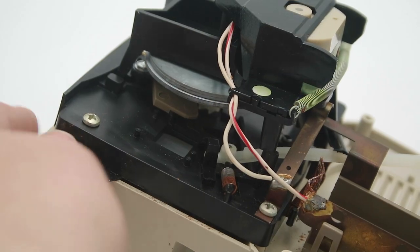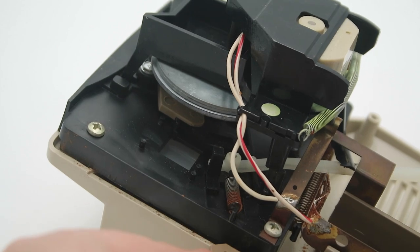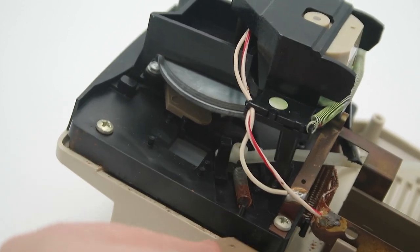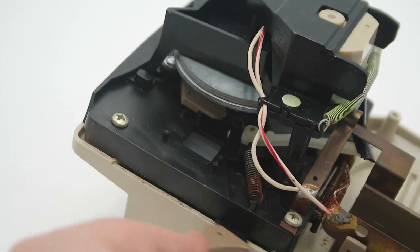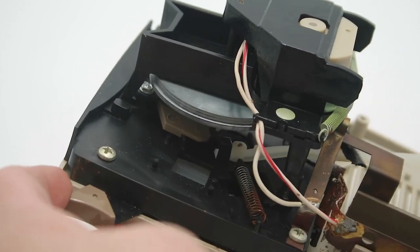In order to ensure the stereo pairs and audio are synced up, the needle starts at the outside edge of the record and advances from track to track as you go along. This is done by a ratchet mechanism — every time you hit the advance arm and turn to the next stereo pair, it also pushes the needle further into the record. In between each track, once it's done, that needle rides inside a run-out groove until you advance it to the next.